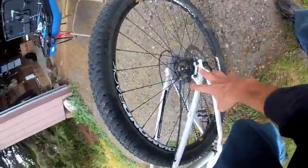This bike has a rotor or disc brake system, with calipers near the axle. Spin the wheel — we don't want significant rubbing from the pads to the rotor. Some slight contact can happen, but we don't want a lot of drag on the caliper.